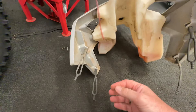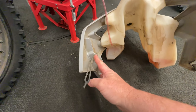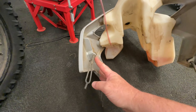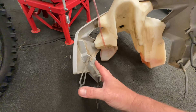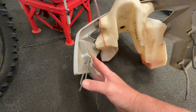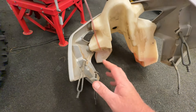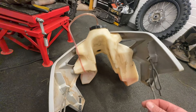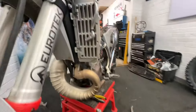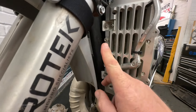The reason behind this is basically to prevent these holes getting damaged. If these shrouds are screwed onto the radiator fronts and you get an impact, you can get damage here — the holes break. With these straps, it makes it so much easier: firstly to take the tank off, and secondly to prevent any damage. They just hook onto some bolts on the front of the rad braces.